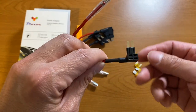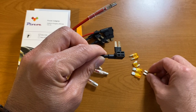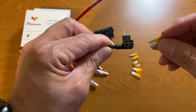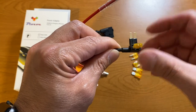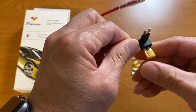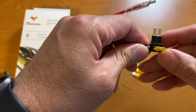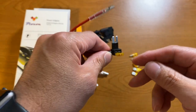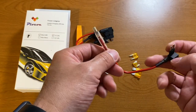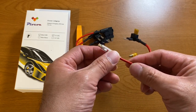What you're going to do is take out the existing fuse in the fuse panel — I'll show you which one in a second. You take that existing fuse out and put it on the top slot. Then from one of the provided fuses, you plug it into the bottom spot. So the provided fuse goes on the bottom, and the existing fuse you pulled out goes back on top.